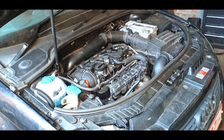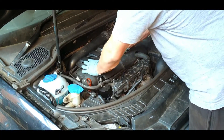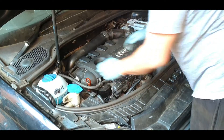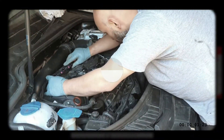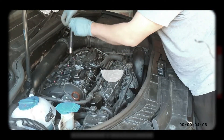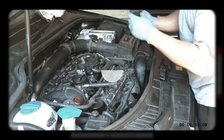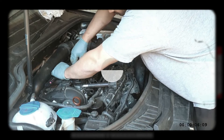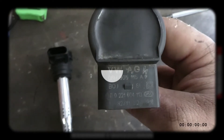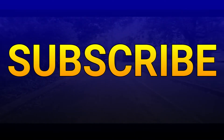No more shaking, no more jumping — that was the issue. So if you've got a faulty shaky engine, don't panic. Put it on an OBD reader, see which coil pack it is, and swap it over before you spend a penny. Once you've confirmed which coil pack is faulty, just take the part number off the top, put it into eBay, buy it, fit it, and you're sorted. Thanks for watching — please like and subscribe and I'll see you again.